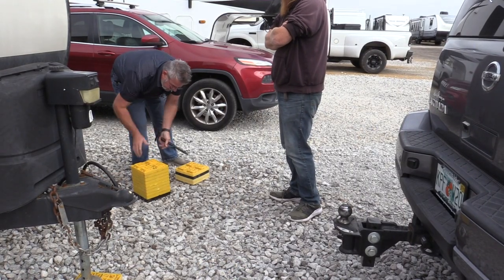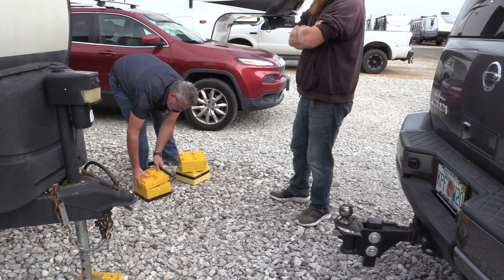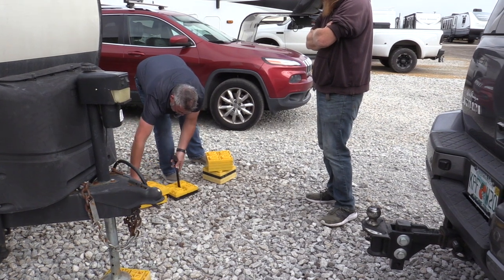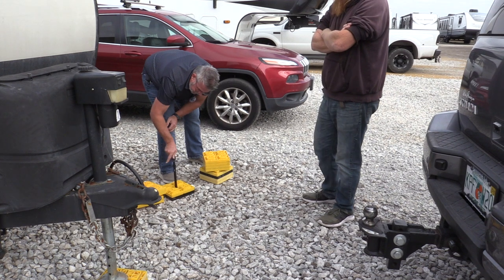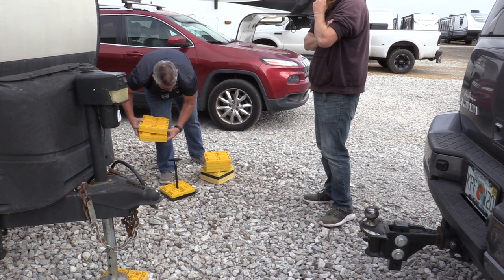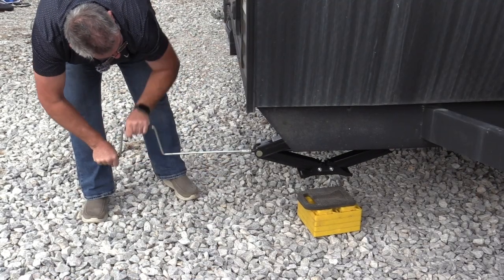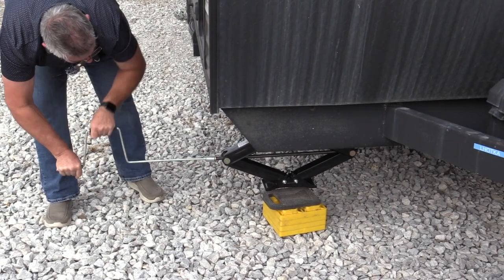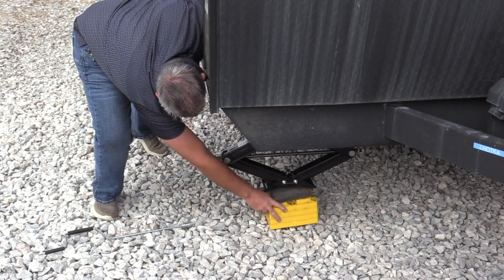Now it's a matter of putting some spacers underneath the jacks. This is not required but I love these little blocks — you can get them at Camping World, about 10 blocks in each pack with a little screw-in handle. It helps avoid how far you have to lower the jacks and keeps them in a more stable position. We also have this rubber pad that goes on top — it helps reduce noise inside the camper and works shockingly well. Worth picking up. I can put some links in the description below.